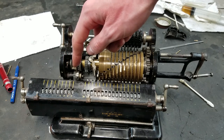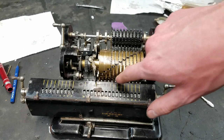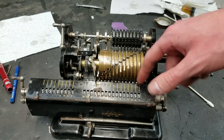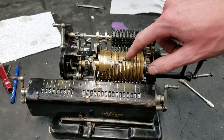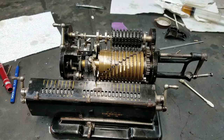At the very end of the fixed section, the reset finger, which would be akin to these lumps here that push the carry reset back into its non-trip position, that piece is free floating before the actual finger piece is free floating. And I didn't know that there were supposed to be washers in between that, so those extra ones actually went in there. And I thought that fixed it, but apparently not, so I have to look back into that.